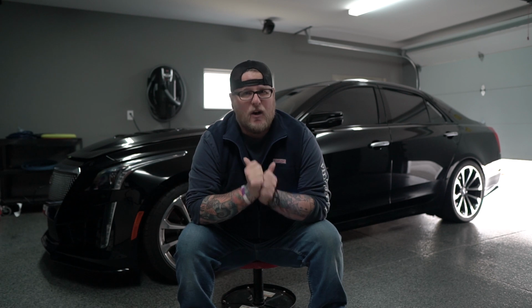The third thing that I don't like about the CTS-V, or hate, is the transmission. The transmission in these cars and in the Corvettes are horrible. I had a C7 Z51 before this car. It had the same transmission. It's clunky. It's super clunky. And what I found out is that the transmission fluid straight from the factory had an issue with creating condensation. And so there were issues within, I don't know the engineering behind it. All that got explained to me was that the other fluid created condensation and that was the issue. So they created a new formula for transmission fluid. That did help. It didn't resolve the issue completely, but it did help.